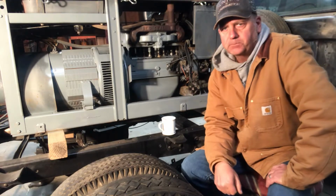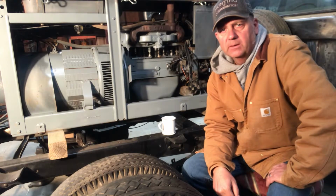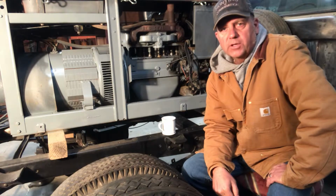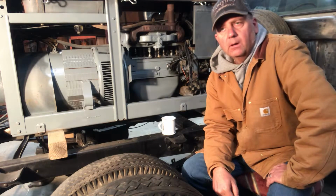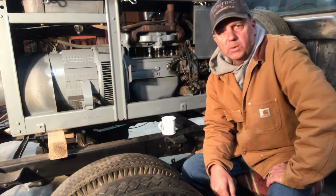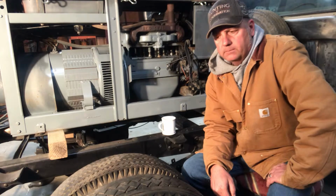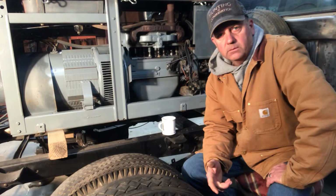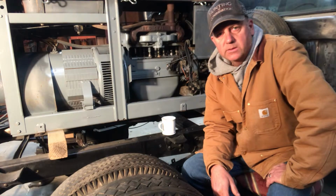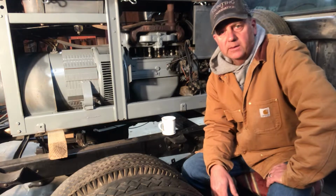It was great. So called an expert in Arizona, and he said, it's got to be your fuel. You're starving it. So new filter, new screen on the sediment bowl, no change. So I'm thinking, okay, we got fire, we got fuel, we need air. So I'm thinking maybe the oil bath is choking it down. I cleaned all that out. I thought that was fine.